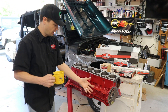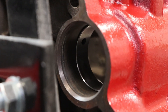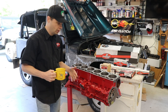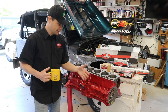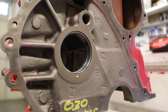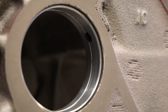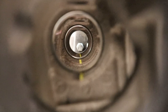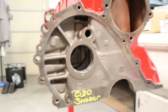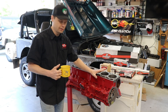They painted it a nice cool red, and they also installed the cam bearings for me. You can install your own cam bearings, but to me it's not worth that hassle. You have to have a special tool which I can't rent or borrow anywhere around here — it's an expensive tool, cost a couple hundred bucks — but for them to install the cam bearings was like $50. So I can have them do that many times for the cost of a tool, and they're done perfect. The cam bearings can get tweaked or off-centered; you can ruin them. Having the machine shop do it, it's professional with no problem. The rest of the assembly I'm going to do myself.